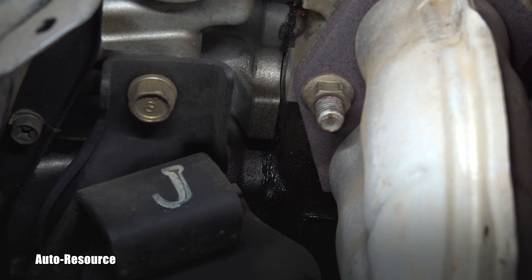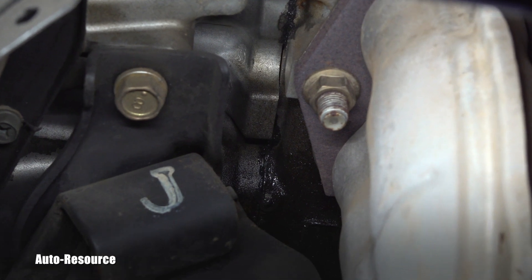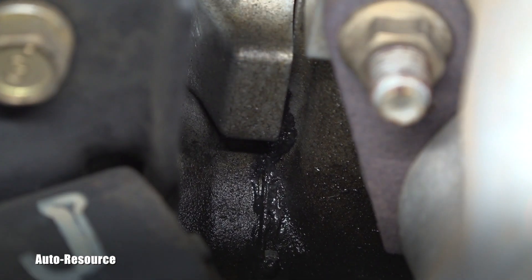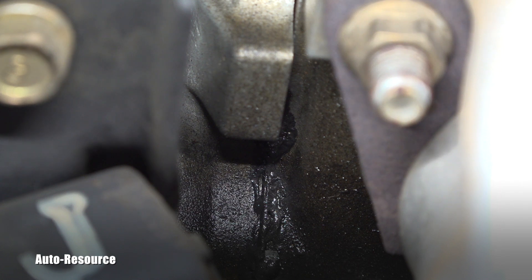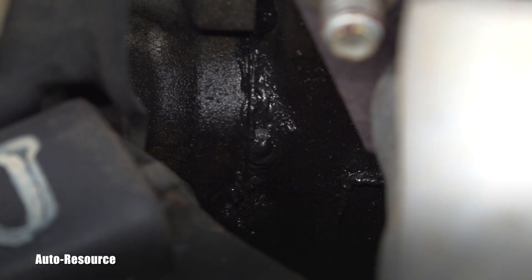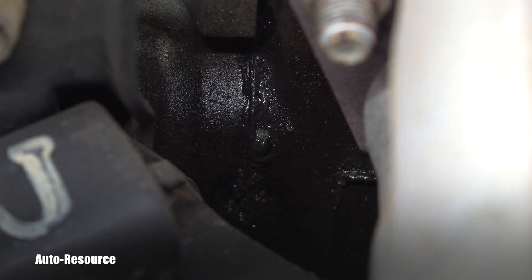Moving the camera — this is where the nightmare begins. Back there, there is a huge, massive leak towards the back of that head. There are hanging amounts of a mixture of coolant, engine oil, and so on. Looking in the very back, this is where all that craziness keeps happening — a huge oil and coolant leak dripping down onto the steering rack.